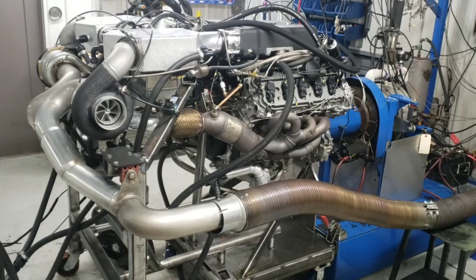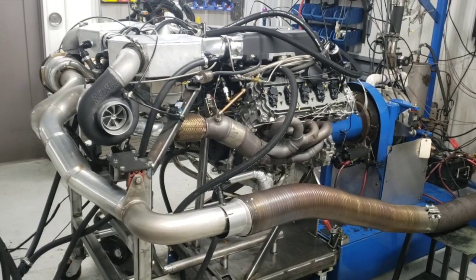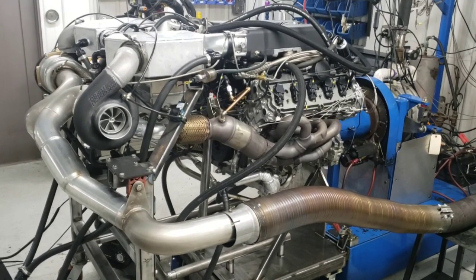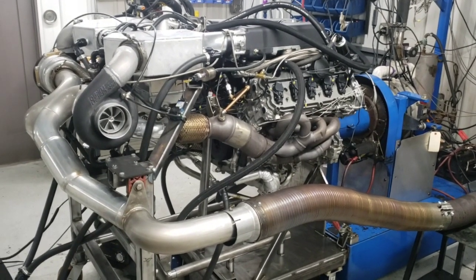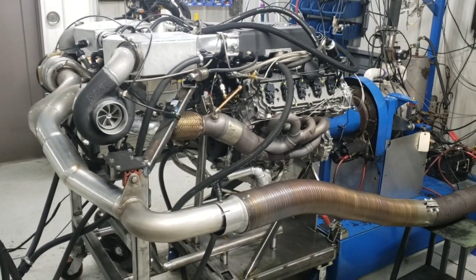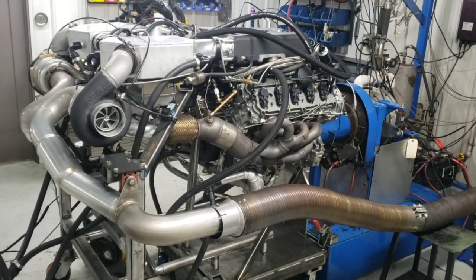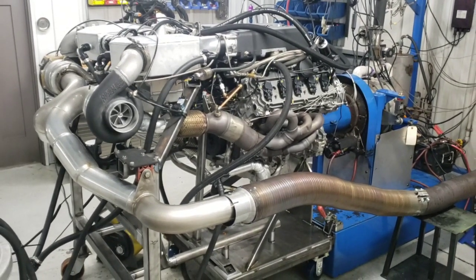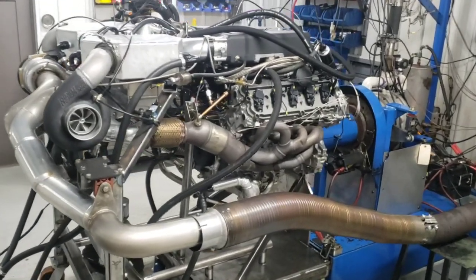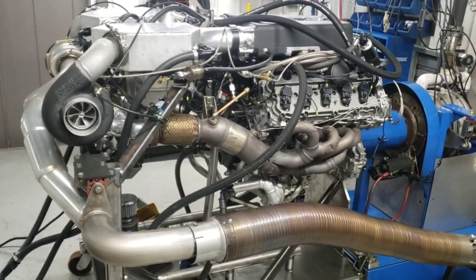But the next steps will also be that we're going to be working on development with them on the next 3,000 plus horsepower stuff with the billet blocks, and we're working on piston and rod combinations with them, crankshafts. They're machining and building the blocks in house, or going through that kind of thing with them. Then we go through the cylinder heads, working on camshafts and the phasers and possibly lobe profiles, and going to do some work on that. So a lot of stuff going on here. A little bit after the dyno pull, I'll show you the billet blocks that we have in process for the next builds.